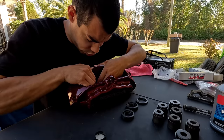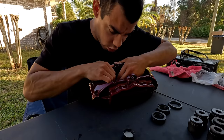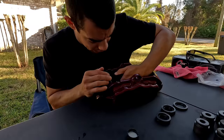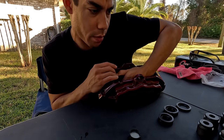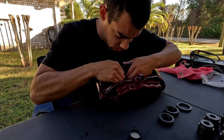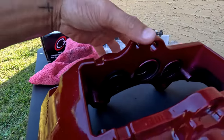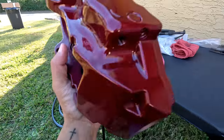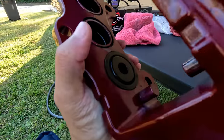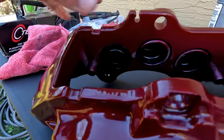Get it lined up and you should be able to just push it all the way in. I got it part of the way but it felt like it was catching on the seal, so I pulled it back out and re-lubricated the inside so it can slide past the seal without jamming or pinching it. One of the best feelings is when you think your camera is recording and it's just not — I missed that entire last bit. But the first one is now in, seal popped into place, piston back in — good to go. Use plenty of brake fluid or silicone grease for this step.